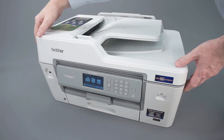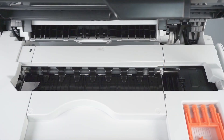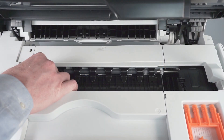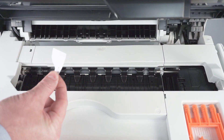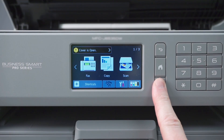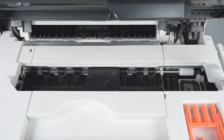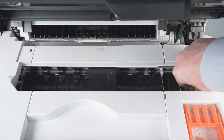We will begin by opening the scanner cover. Check the platen area and remove any ripped paper or other obstructions. Verify that all blue packing tape has been removed from the printhead. If the printhead is in the locked position on the right side of the platen, press and hold the red X on the control panel for 5 seconds. When the printhead moves to the center, check the right side of the platen for jammed paper.